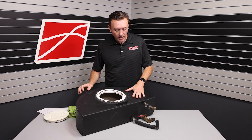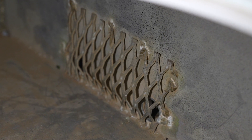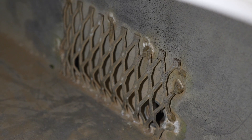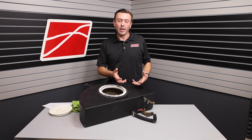Finally, the thing I see about this tank — it's kind of hard to see right in here over the pickup — but it's very small, and these pumps flow a lot: 10, 20 gallons per minute. You need to be able to get a lot of water in there, and you need to keep the ice from getting into the pump and clogging it.